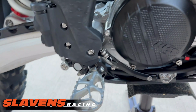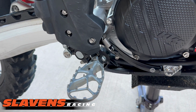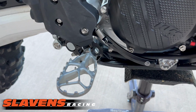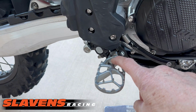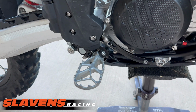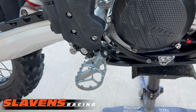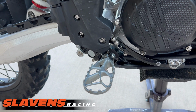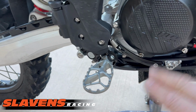And let me think here. All right, foot pegs. I normally run the Fastway Evo 4s, but they just don't have them out. So right now I'm running the Stalkers, and I don't like the real sharp tips because I have a problem with my boot sticking for a split second longer than it should on the peg when I go to dab, and that delayed reaction makes me fall over. It's mainly when I'm sitting because I'm long-legged, I kind of get wadded up on the bike, and any little thing like that holds me up.